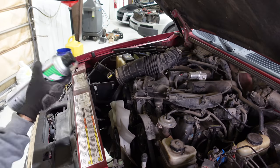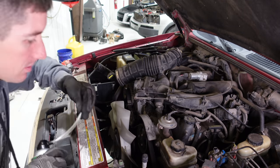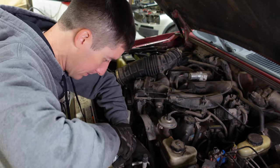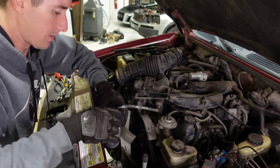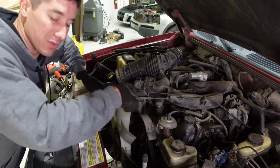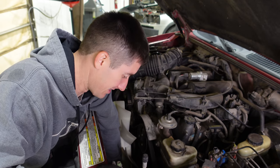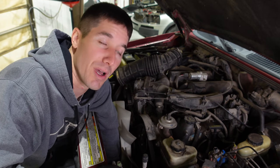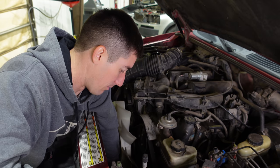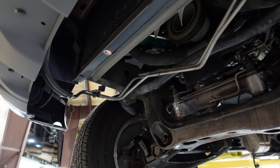So much better. Here's round two of our cooler flush. This is going to get that external one all cleaned out. This one runs all the way back, so we'll go ahead and give it a hit. And now let's hit the other one. We have clear fluid pouring out back there again out of the other line, and that was the one that was flushing the entire cooler out. I'm going to run the whole can through here, then we'll clear it with air, then it's finally time to reinstall the new radiator. Usually you use half the can to go one way and half the can to go the other way, but this time everything's open so we're just dumping it out onto the floor — I'll just wipe it up.